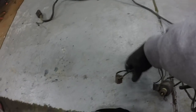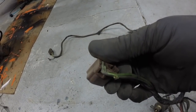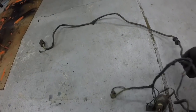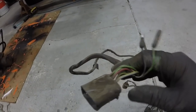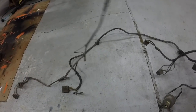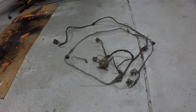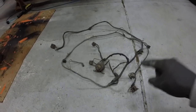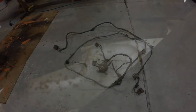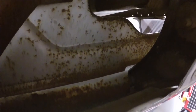I've got that to repair — it's all like the same color wire, light green, like they had a problem with the headlights. The rest of it is okay. This is where it plugs in at the firewall and everything else looks pretty darn good. I'll have to fix and clean it up before I put it back in. I am not going to buy a reproduction harness — I am going to repair this one and put it back in. This is the front valance between the radiator grille and the bumper. That's bare metal, and it's just very lightly surface rusted in places. Really in nice shape.